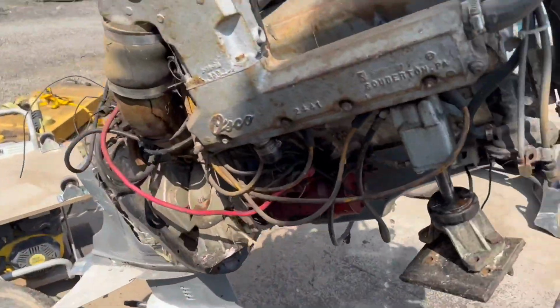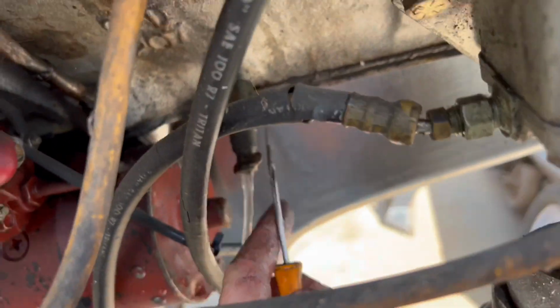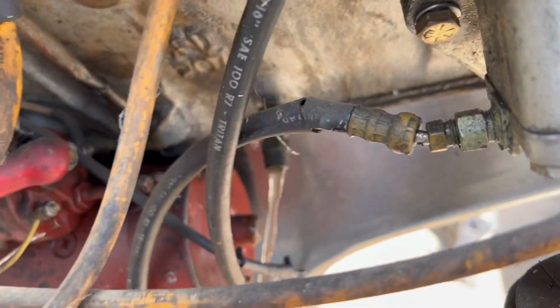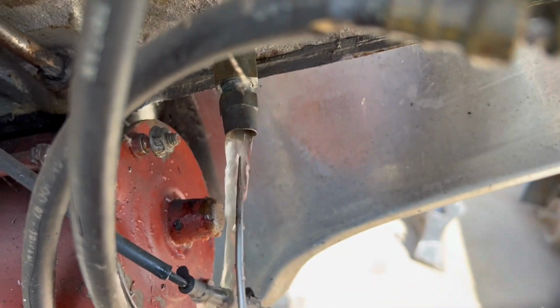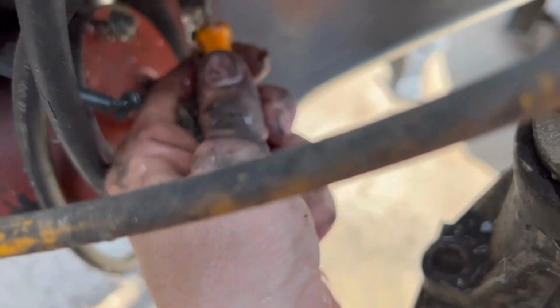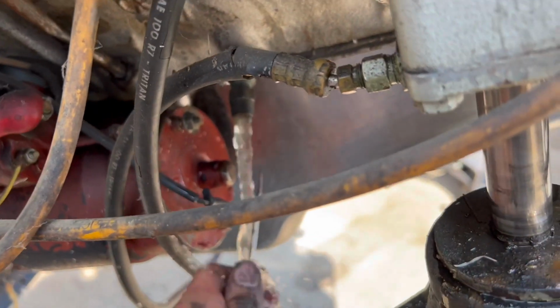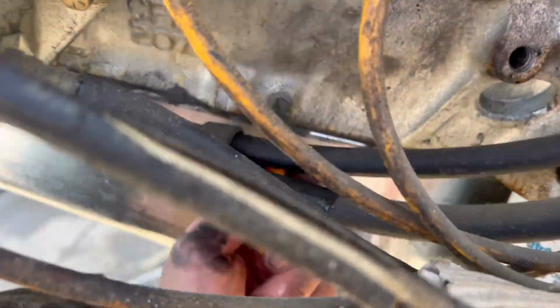All right, draining the drain plugs on these things, it's best to have something like a screwdriver, something really skinny, to poke through the actual engine all the way once you get this little plug out. There's a lot of rust and sediment that sits at the bottom of these. So you see all the rust. You gotta, every time, just clean it all out, get the chunks out of it. Otherwise, all that stuff just sits in your motor when you're not having any water in it. There's a lot of stuff in them. I got pretty much everything out of this side. Well, that's it.